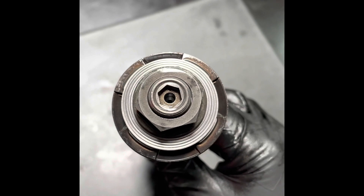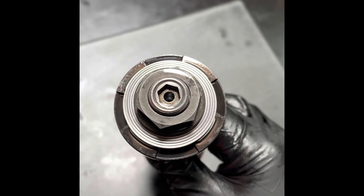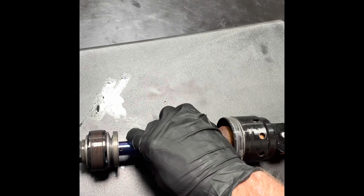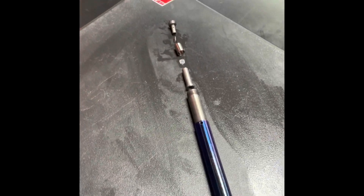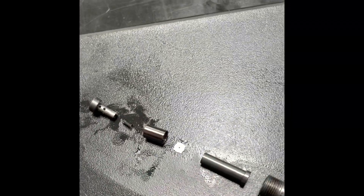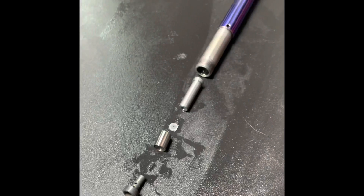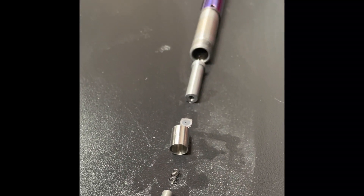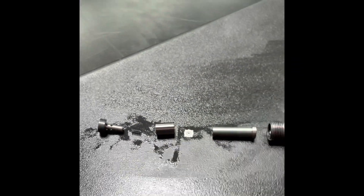This is usually most beneficial for supercross riding and supermoto — mostly applications that require a lot of low speed compression. This is what the shock shaft looks like on its own with the internal shaft jet removed. We are going to modify this part of the shock for motocross riding. It's a really neat feature of all Showa A-Kit shocks that I have seen. Being able to tune this feature is really beneficial and very easy.